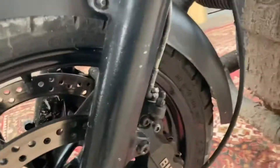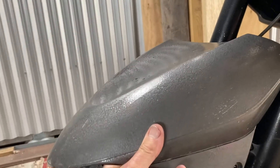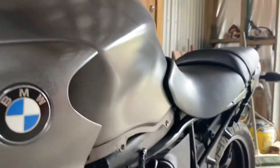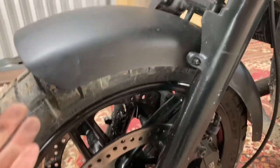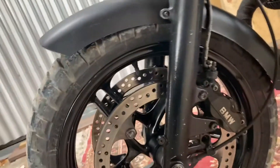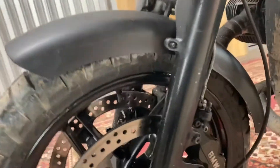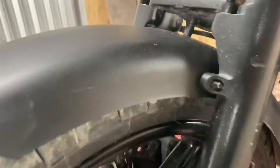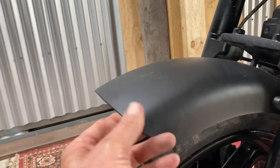Now the front guard — most BMW owners know it's got that little plastic bit at the back that hangs down and a plastic bit at the front that sits up, which is really cool. I did try spraying it to see how it fitted in, and it gives you that streamlined look which BMW went for. However, I found this one on eBay — it was made in China and advertised as a rear guard for a Harley, made for around a 20-inch rim. BMWs are 18s front and back, but it fitted really, really well. I think it was about 60 bucks all up. All I had to do was drill a couple of holes and change the bolts out slightly to fit. I was thinking of spraying that coil yellow to make it stand out a bit industrial, but it's worked really well and it's solid.